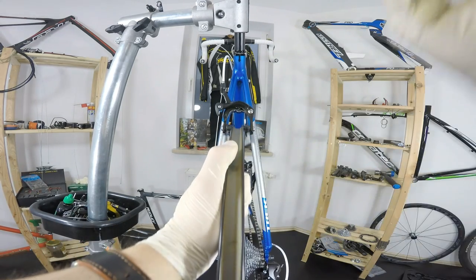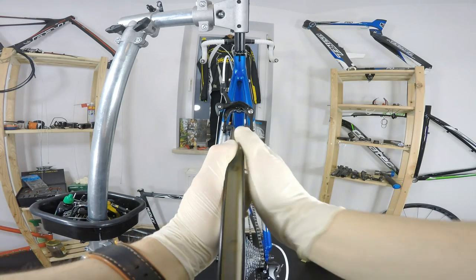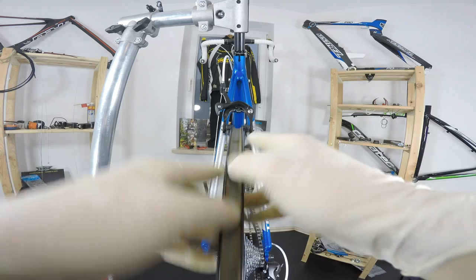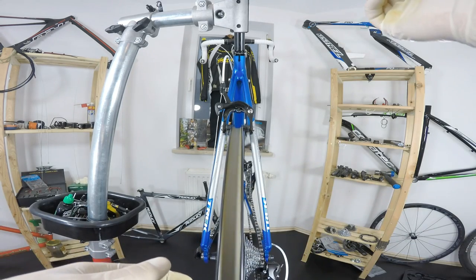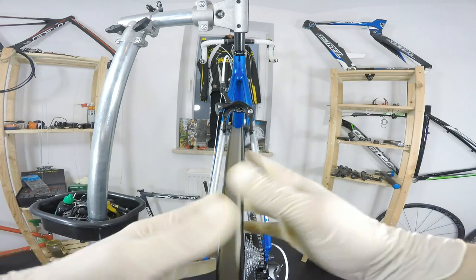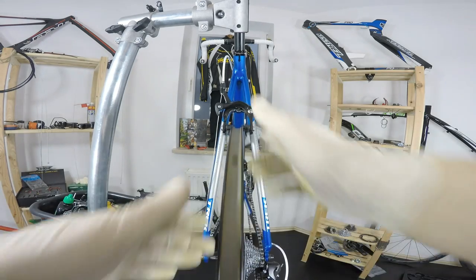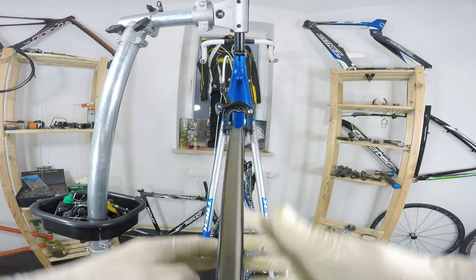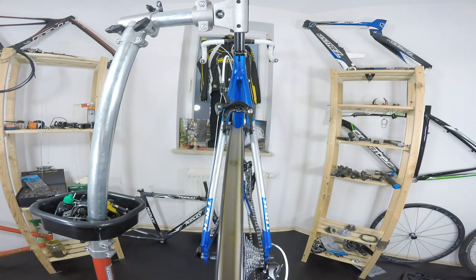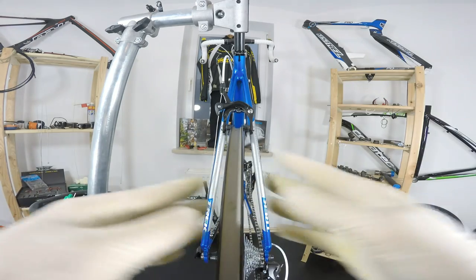In my practice, after truing the wheel, I would always, after one or a couple of rides, go back, check it carefully and maybe tune up some of the spokes. If we do that, the wheel will really hold and will be true for thousands of kilometers. So this is what I wanted to share once more.